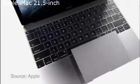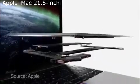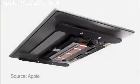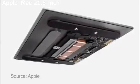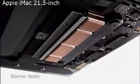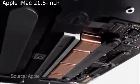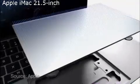So what exactly makes the new Trackpad 2 so expensive? Well, it starts with Force Touch. The same technology that has been added to the MacBook Pros and the new MacBooks now makes it to the desktop thanks to this accessory. So that means we no longer have a full physical click in this trackpad. It's now replicated via a Taptic engine. There's actually a motor or electric motor underneath the surface of the trackpad that simulates a physical click.